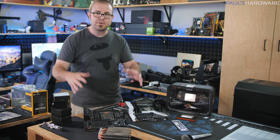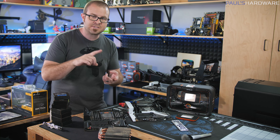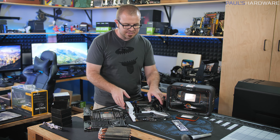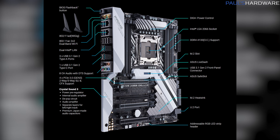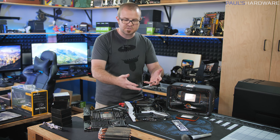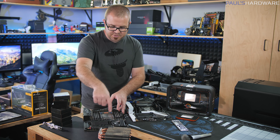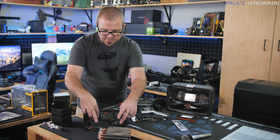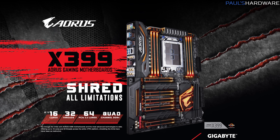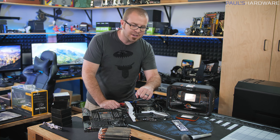The next choice is going to be the core platform. We're going to high-end desktop here since this is going to be a video editing system, and I have two choices. I've got X399, which is the Threadripper platform — currently supports first and second-gen Threadripper, and will probably support third-gen Threadripper when that comes out later this year. Then we've got Intel's X299 high-end desktop platform, and our candidate for that is the Asus Prime X299 Deluxe — a motherboard I've already used, so it already has a Windows license attached. Both boards have eight DIMM slots for DDR4 memory. The X399 board, the Gigabyte Aorus X399 Gaming 7, has three M.2 slots, whereas the Asus board has two M.2 slots and also a U.2 slot, which can be used for an M.2 drive with an adapter.